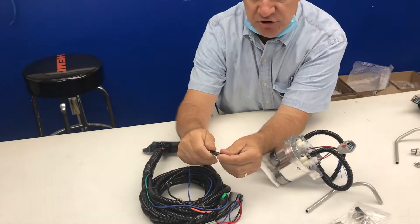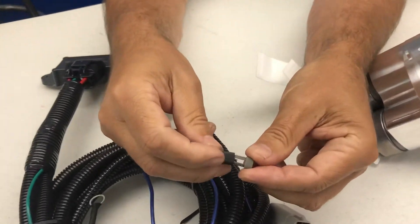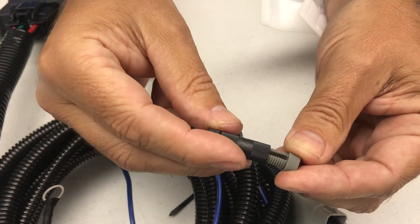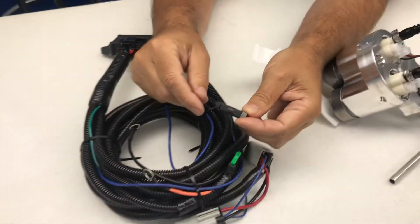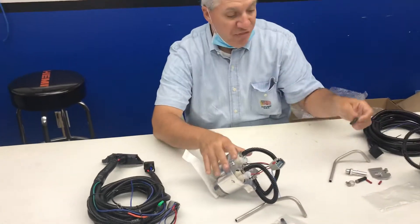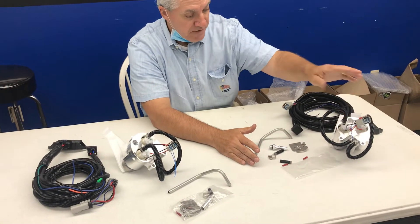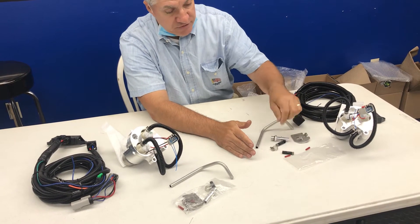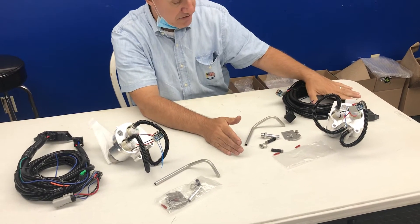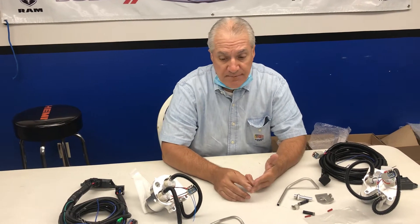The other end, so that you don't have to cut the wiring in the vehicle, has this type of a tap. It comes apart, the wire gets pushed through — same scenario. Military style taps, no soldering, very quick, very easy. Takes about 30 minutes to install. So once you get into the kit, you get the fuel pump system — it's all been pre-wired — one bracket, a couple of fuel trims, a clamp, two red connectors, two black connectors, and the main harness. This is capable of sustaining at least 1,000 wheel horsepower, whether using E85 or race gas, depending on the setup of the car.